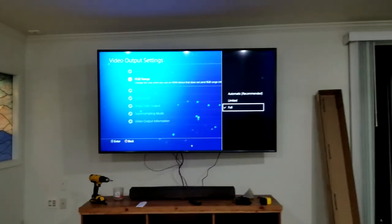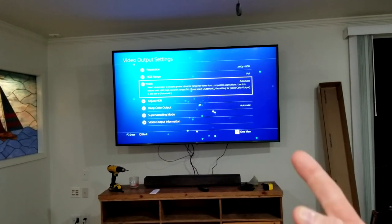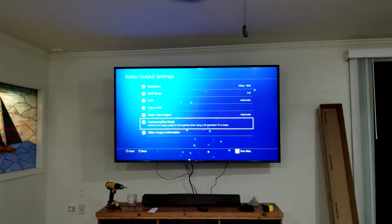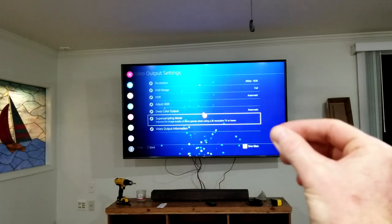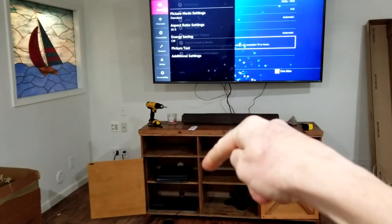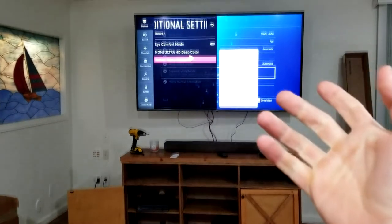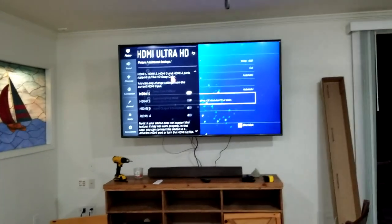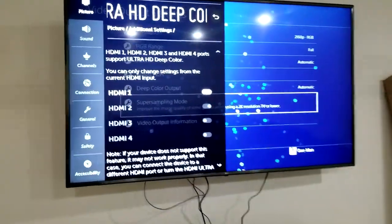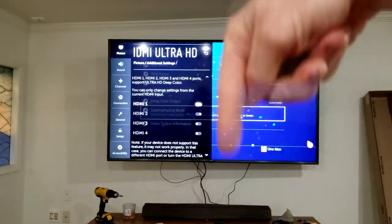If you don't have an extra HDMI cable laying around, you can try this if you only have one HDMI cable: most people have some extras lying around, so just try a different HDMI cable. Or unplug the TV from the outlet and then take out the HDMI cable from the port, and also take out the HDMI cable from your PS4. That's going to reset everything and then plug everything back in. But most people have multiple ones, so just try a different cable, more of a newer one. If you don't have one, then just pick one up — I'll leave a link in the description box below.